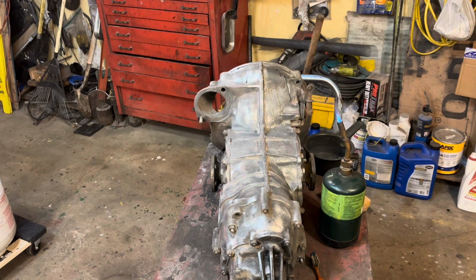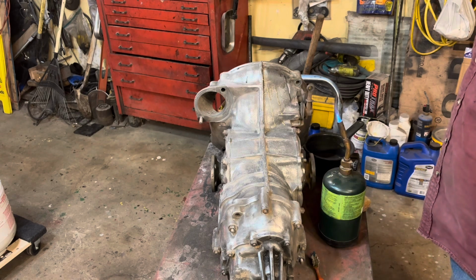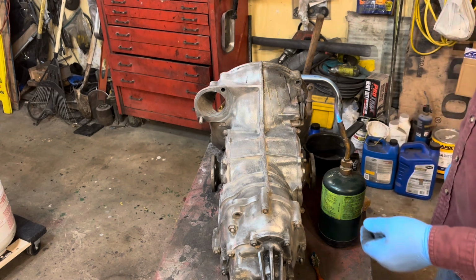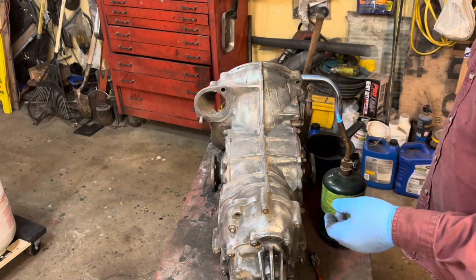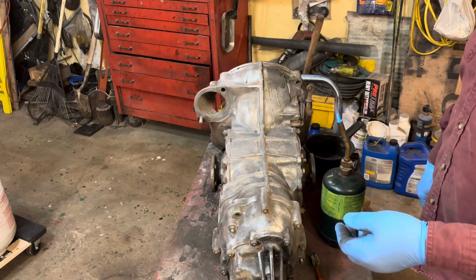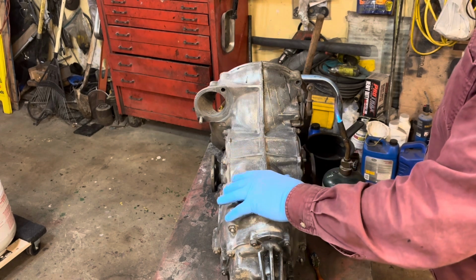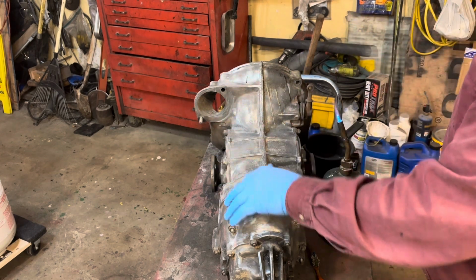All right. A lot of people paint their cases and their transmissions. The transmission and the case were made from magnesium. It was made because it was cheaper. It was a cost thing. It was cheaper than aluminum and easier to machine. And if you do it a certain way, with ribs and stuff like that, it's actually stronger than aluminum. However, magnesium becomes brittle after time. They didn't think their cars would last this long, I guess.